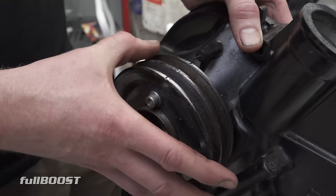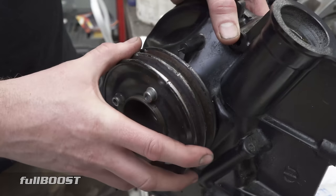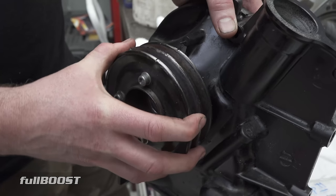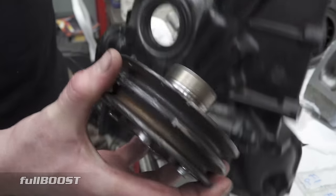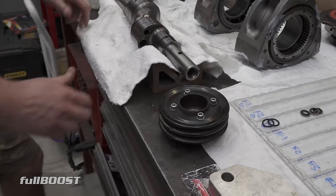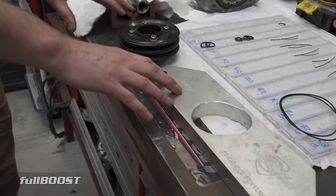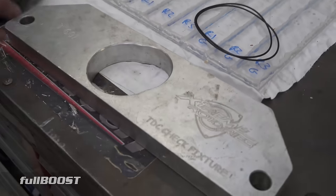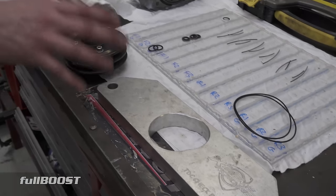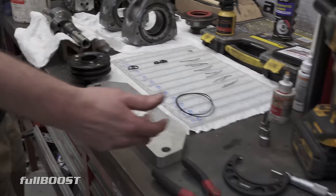There are different pulleys and different marks — there's a mark there and another mark there, those are the factory marks. There's no guarantee that those marks are spot-on for every engine when you're changing parts. One of the biggest things with rotaries and timing is: too little timing could lead to high EGTs and being down on horsepower. Too much timing could lead to the engine blowing up. Timing is really, really critical in a rotary engine. I use this tool with every engine I build to properly dial in true top-dead centre, so when you go to tune the engine everything is right.